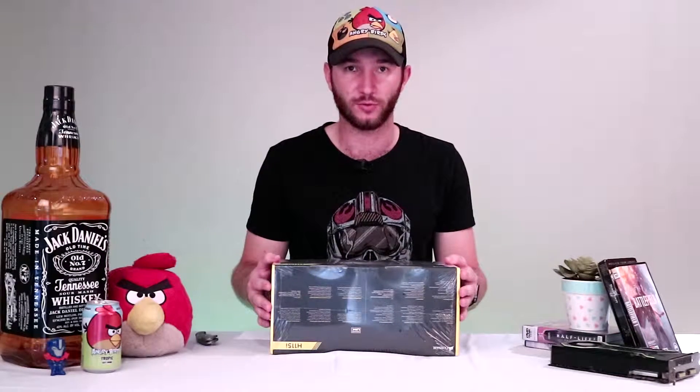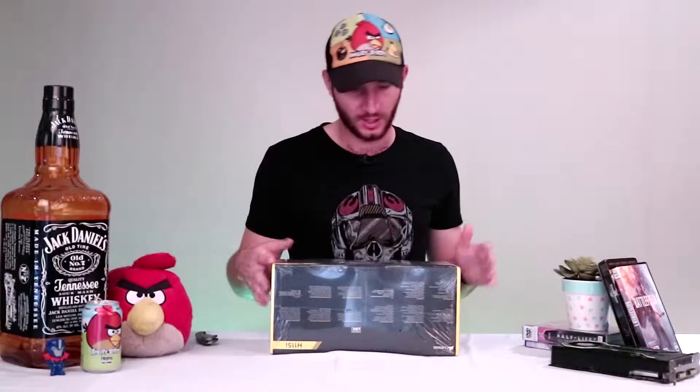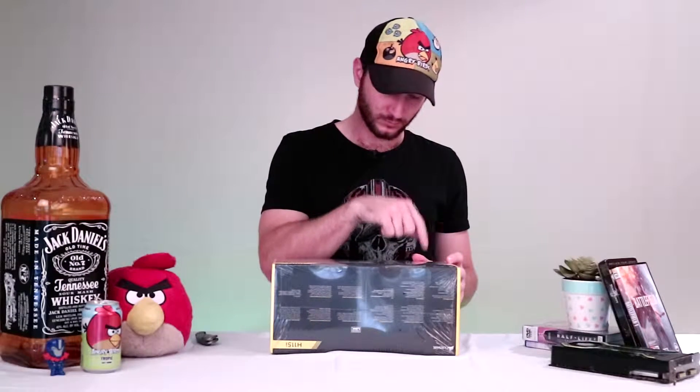If you saw my video about the Asus motherboard that I bought, the Formula 7, I spoke about the fan headers on the motherboard itself. Because what I've got is an NZXT H440 case and there is a fan hub at the back. But the problem with that is that all the fans run at a hundred percent all the time — you can't use SpeedFan, you can't use anything. With that motherboard and with this cooler, I'm going to be able to control the LED and fan speed, all as part of the unit.